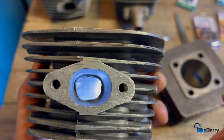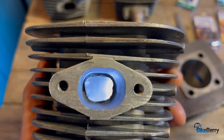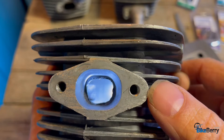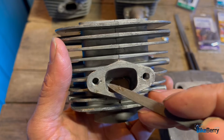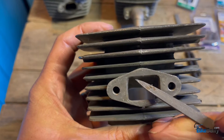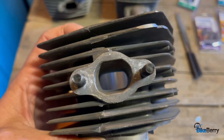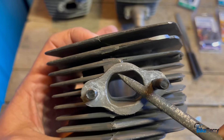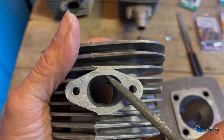To get a good idea of flashing, check out the iron sleeve — see how much is in there. You want to make sure there's plenty of iron around it that you can come in and clean up nicely. Another level in maximizing efficiency is to make sure the corners are rounded. This one has nice rounded corners compared to this one that's square — we'll go in and open them up a little bit and round out those corners. Same goes for the exhaust side: see how it's flat with a hard edge and then does a curve? We want to make that as rounded as possible, like this one here — that's a good example.